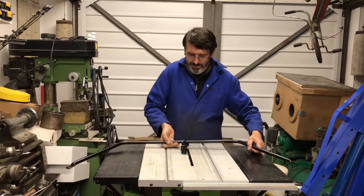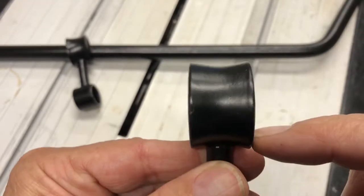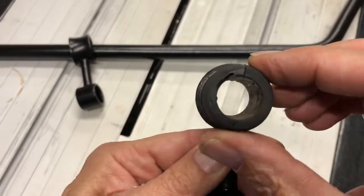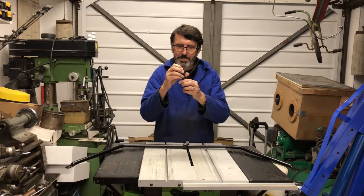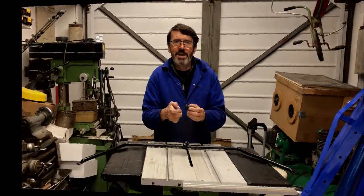And on the drop link, there's a contoured shape. You can probably see it here. It's contoured, V-shaped, and that's replicated inside the link. So this thick bit's going to squeeze between that lower bit here and the bar, and that's going to be a bit of a challenge, I think.